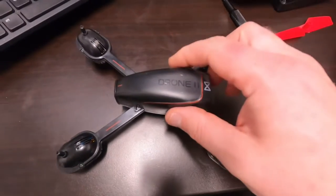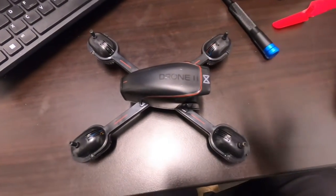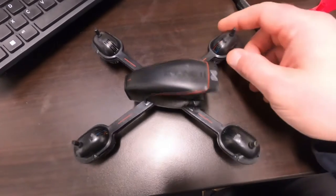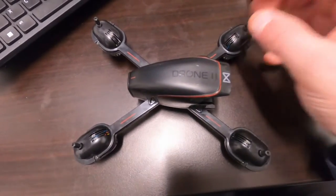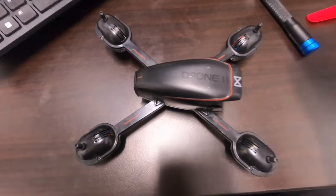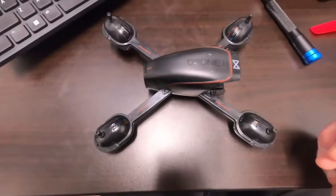This is one of the drones that's working but not working. Whenever I turn it on, I connect it to one of the working transmitters, take the propellers off, and check if they spin — this one worked. But when I put the propellers on and started the flight test, it did not work. One of the propellers slowly works. I thought it was a pairing issue but it paired perfectly. Another troubleshooting step: clean the propellers and the bushings inside them. That's what I'm going to do now.